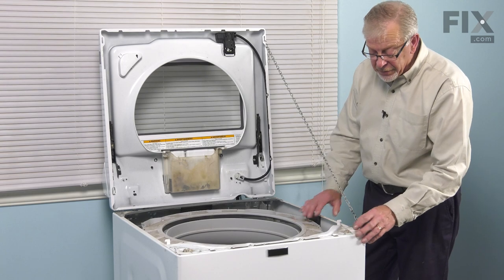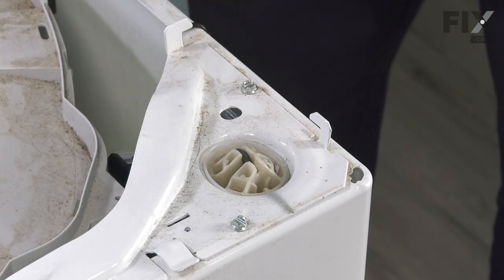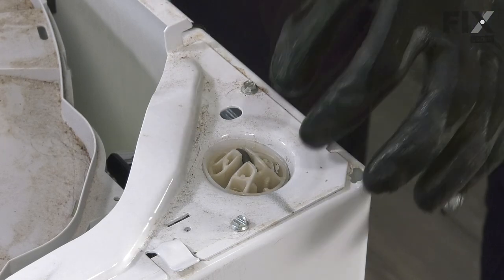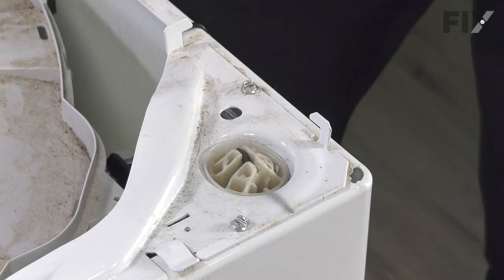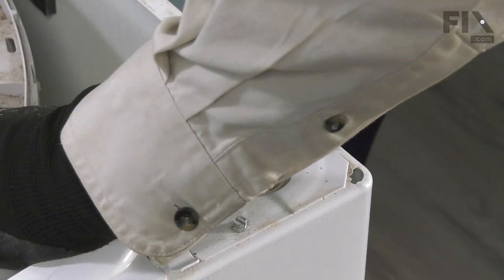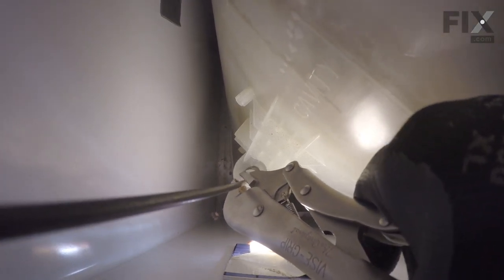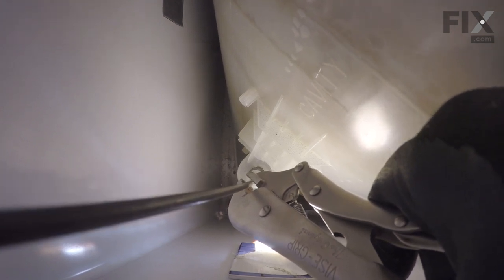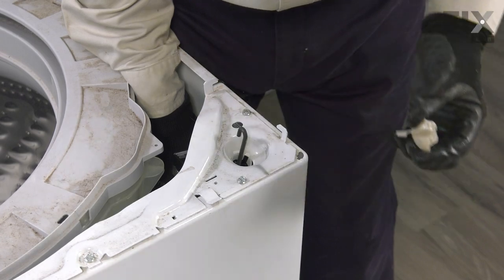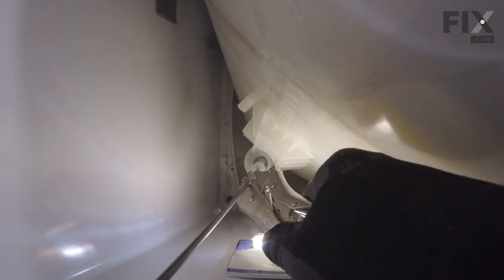Now that we have that secure, we're going to go ahead and lift up on the suspension springs one at a time and replace those. We're going to take a pair of locking pliers, reach down in between the outer tub and the cabinet, and grasp that suspension rod, lift up on it so we can pull that socket out of the top and disengage it. Once you have a firm grip on that rod, we're just going to lift it up. We'll rotate that ball on the top so we can lift that off. Now we'll carefully lower that rod down through that opening, and then we can release our locking pliers.